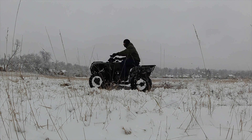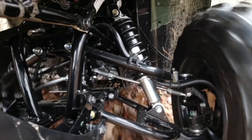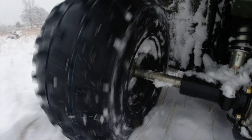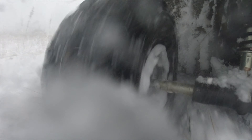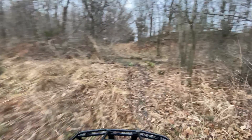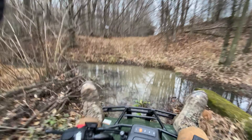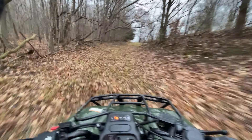Let's take a closer look at the bike and what it offers. You are going to get independent suspension on the front, which allows for better ground clearance and a much smoother driving and steering experience. However, on the back you will not have independent suspension — you'll have a solid axle. It's not a deal breaker; it still rides relatively smooth. Some do complain about a rougher ride from the back. The Honda engineers had to make concessions to keep the price as low as possible, and at least you have front independent suspension compared to older ATVs with solid front axles.